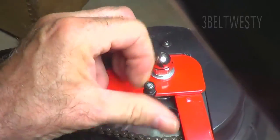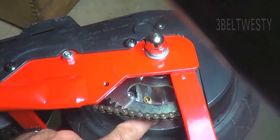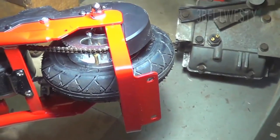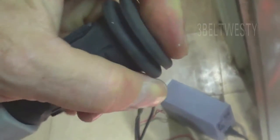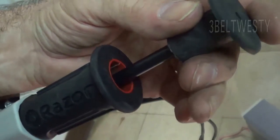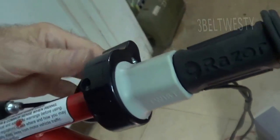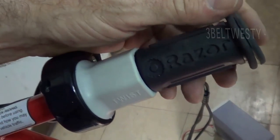Now that this is all lined up, I can go through and fill it up pretty easily. If the tire gets low again, what'll happen is the tire rotates with respect to the rim, the stem gets bent over, and then you can never fill it up — that's probably what happened here. When you're done with the extender, make sure you stick it back in the handlebar grip so you don't lose it. The right-hand grip is a good place to store it.